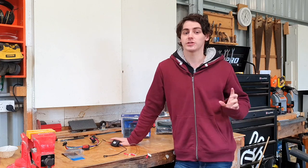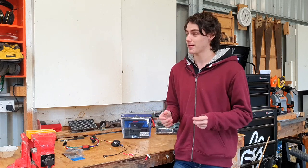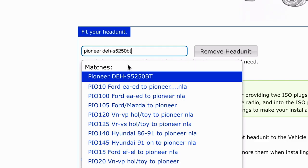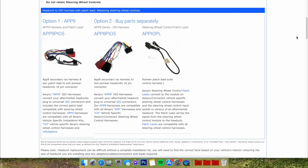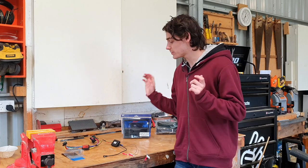All this sounds confusing, but it gets easier when you know where to look. I'm using a company called Aeropro — not sponsored, but hey, if they want to be, hit me up. Go on their website, enter your car — in my case a VZ Commodore — scroll down and enter your head unit model. Then choose whether you want to keep your steering wheel controls. If not, you just need the basic connector; if you do, you'll need the full kit. Scroll further to find installation kits, which include pins to remove your stock head unit, a factory ISO plug, a fascia, and more.